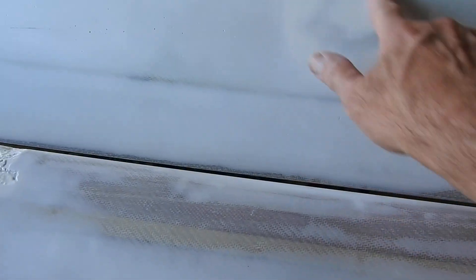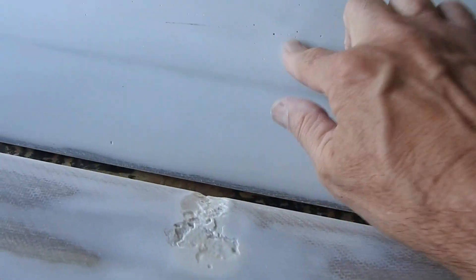And this was that little defect in that aileron that blistered — nice and smooth now. You can see where it was, but it's perfectly smooth. You can see the pinholes and such in there, but the epoxy wipe will fill all that stuff in. They all came out really nice.